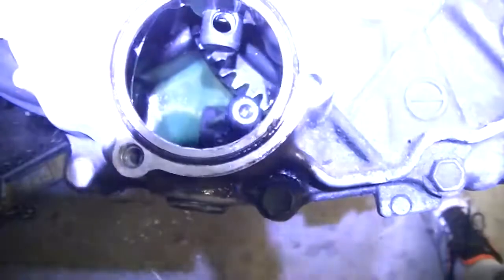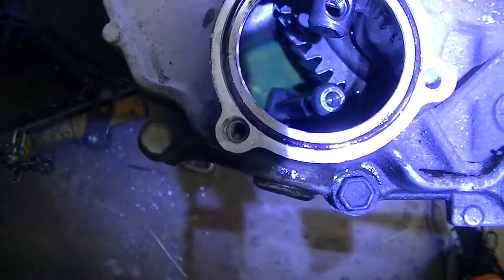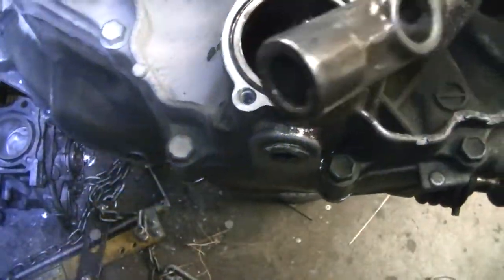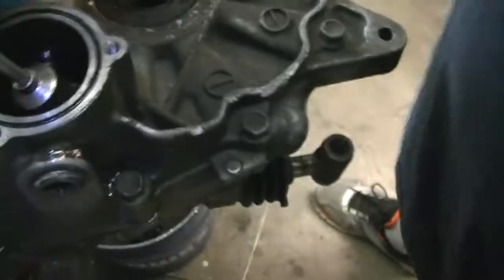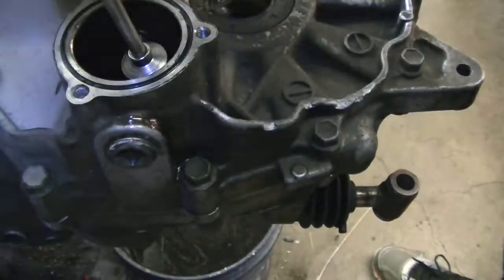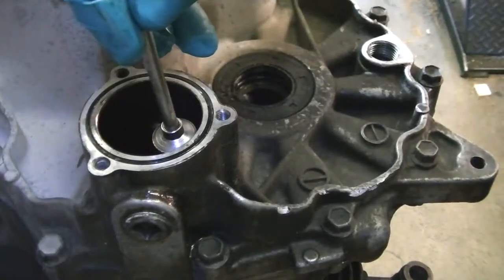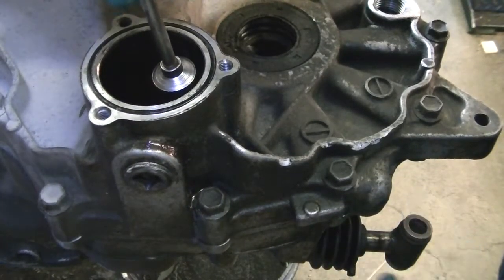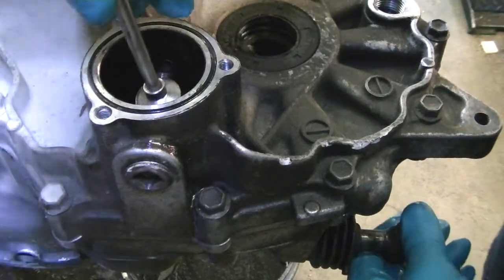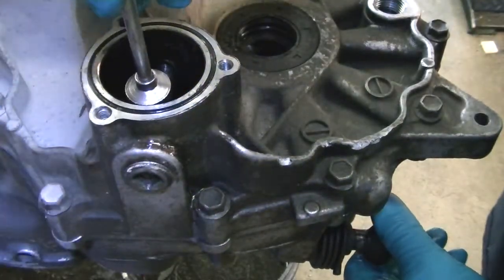Down inside there's a ball socket. You're simply going to take and put the bottom of this — which is a ball — onto the socket. There we go. You get the shifter selector in there and that ball socket inside there, and as you can see, as I move this with my hand down here, that's what we're moving back and forth. So now I've spun that around and put it in neutral, which is just push it until it's in the center.